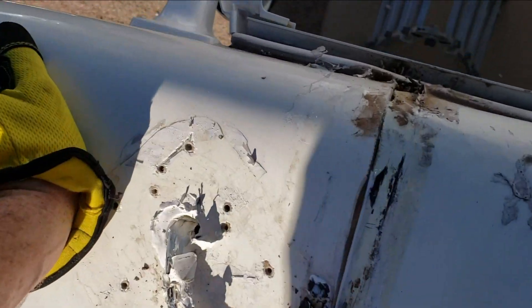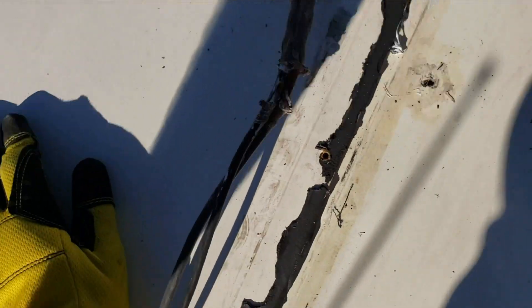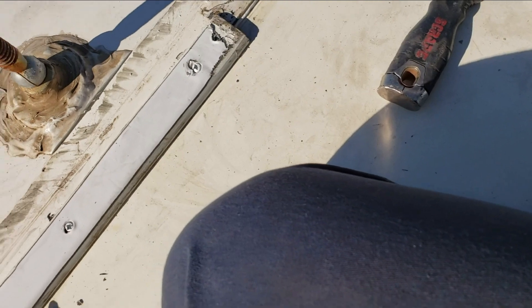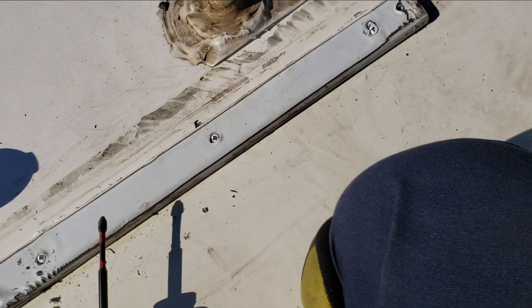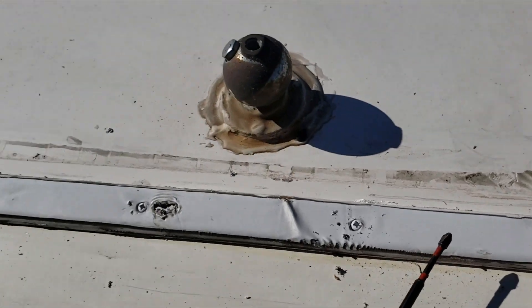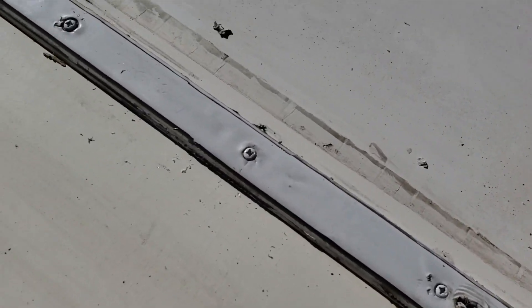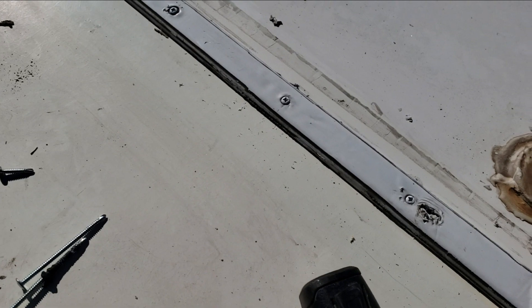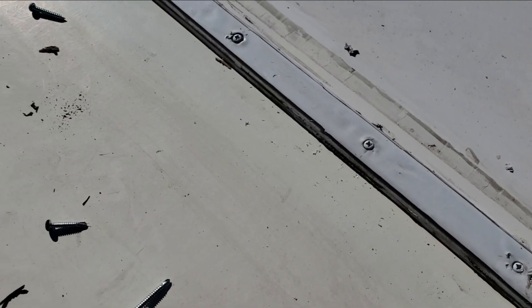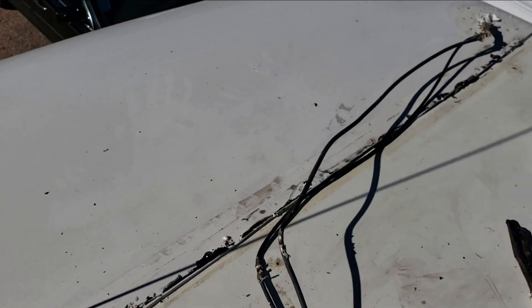With that piece off, looks like it's probably been leaking there for a long time. I'm going to put some more screws in, then clean off. I got this half lined up before sealing — it's easier to do before you seal, because drilling through sealant is a pain and makes a big mess. I'm using self-tapping screws with exterior-grade inch-and-a-quarter square-bit Robertsons. The other side will be the exact same way.